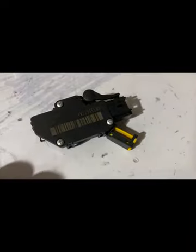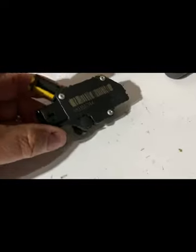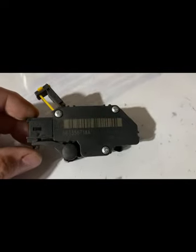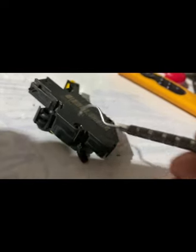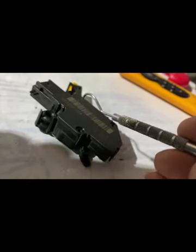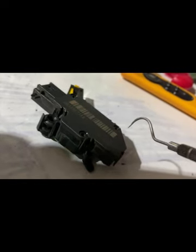I'll be back once I pull that cover off - I'm gonna go get my tripod. This is the part that you may be having problems with. I've got really bad light in here, my apologies. You'll want to push this down because there's another tab under here. Get yourself one of these dental picks if you're going to be trying to repair some of these switches - they're really good for popping these apart. Screws are out and I'm just going to slightly pry and pop those out.